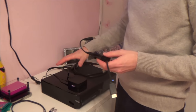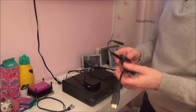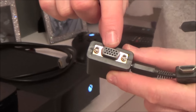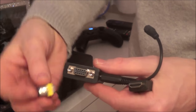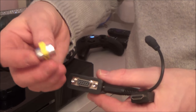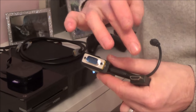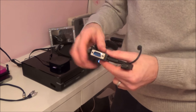If you just have one piece of equipment connected up to the TV, that's all you need. However, you will also need to get yourself a male-to-male VGA coupler, because the adapter is male on the HDMI end but female on the VGA end, yet the TV's VGA port is also female. You can get these couplers for a couple of pounds — you plug it in and it turns the adapter into a male VGA, giving you male HDMI to male VGA.